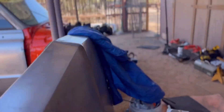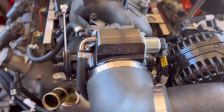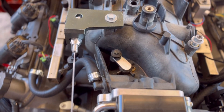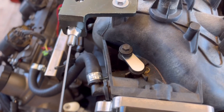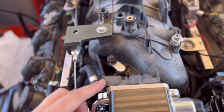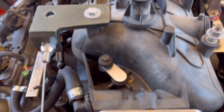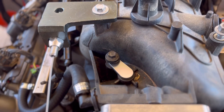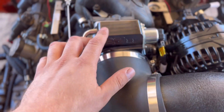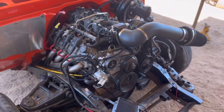I'm coming over here and I'm actually going to be taking the throttle body back off to put my manifold air temperature sensor in. I bought a block-off plate for my evap purge canister thing that was right here. I'm going to take this back off and pretty much just file down the sensor a little bit and then kind of open up this hole a little bit, so I'm going to pull this throttle body off so I can get in there and catch all the shavings. Let's do it.